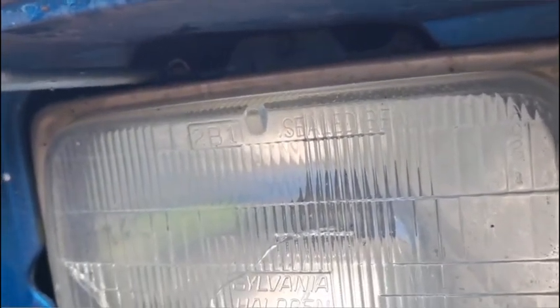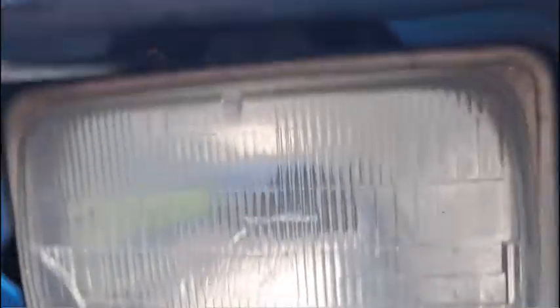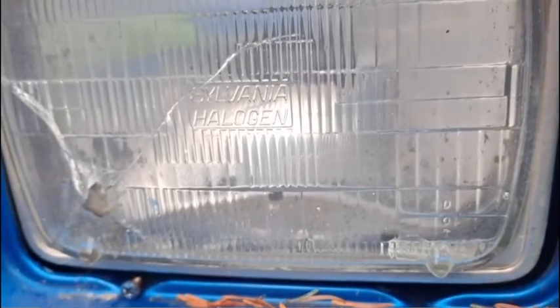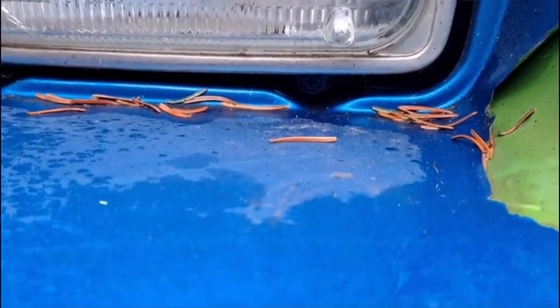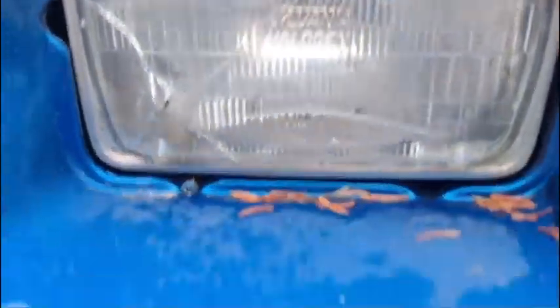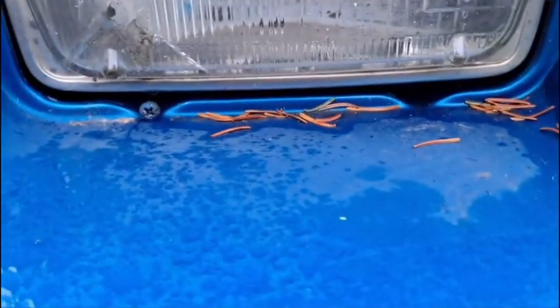I'm halfway through removing the screws, and now would be a good time to point out that if you can get a magnetic screwdriver, that's very wise. If you don't have one, just be a little more careful. You'll want to park the car either on the level or with the nose pointing downhill, because the last thing you want is these screws to land back behind the nose cone — or with the Escort, behind the bezel — and fall down somewhere under the engine bay. Especially if you're doing this in the grass, try to lay down some cardboard so the screws will stand out on a hard surface and not disappear in dirt or soil.